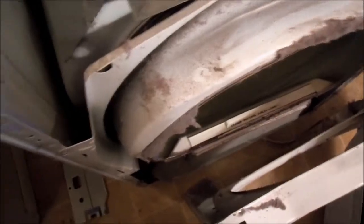So there's one little clip here for the wire on the control panel — take that off. No one knows what lurks underneath the dryer. This brace part here comes off. Four screws basically hold it in place. It's got wires. I leave the wires connected normally unless I have to remove them. Then I can take this bottom panel off normally and I can get to the thermo fuse and some of the other components.